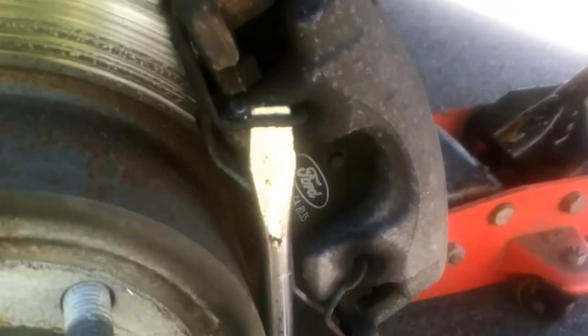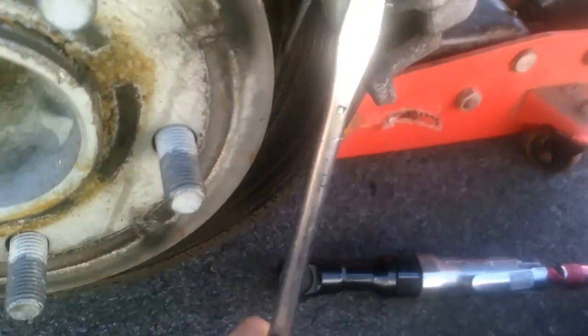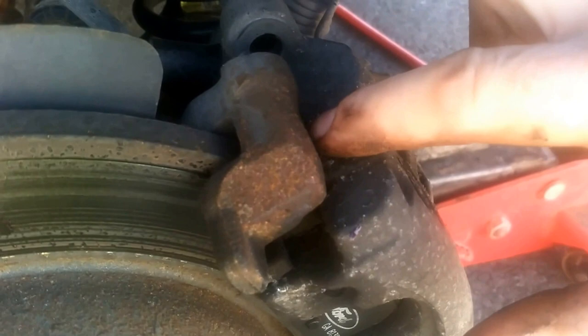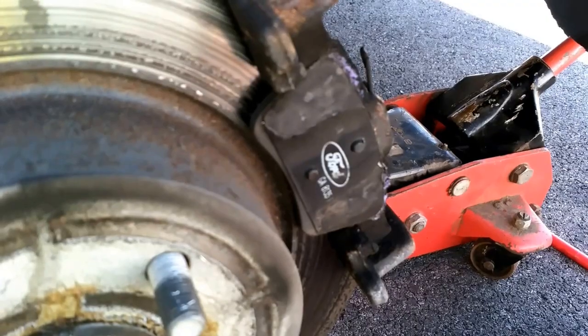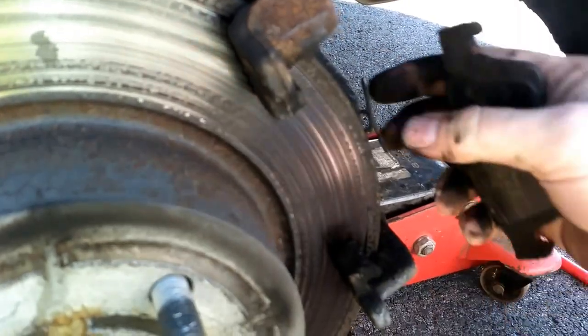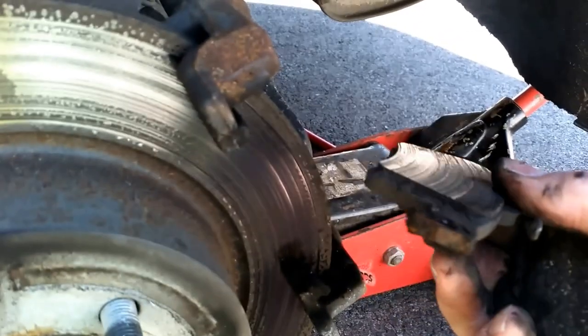This one's going to make it a little tricky, but you just kind of pop it out and do the same with the bottom. Put the clip aside. If you're lucky, you can pull the shoe holder off with your hands; if not, stick a screwdriver in there and pry it back and it'll come off. Now we pull the brake pads off and reset the caliper. The pads just lay in there, so once you pull that shoe holder off they come right out. We had a little bit of meat left, but it was getting pretty warm and needed replacing.